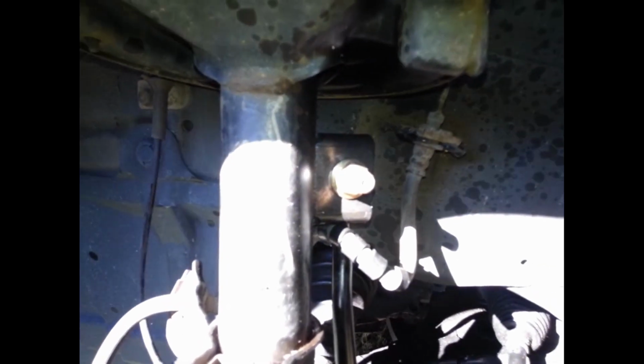This is to loosen your adjuster up. Here's your lock washer, or a locknut. Voila. Again, torque is 65 pounds, 65 or a little bit more. But when it clicks, just go a little bit further, probably 2-3 pounds, whatever. I don't care, I'm a rebel.